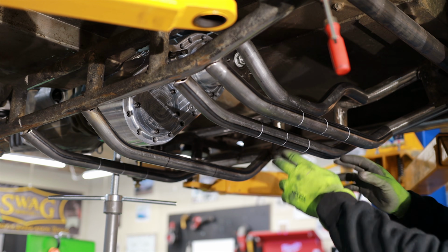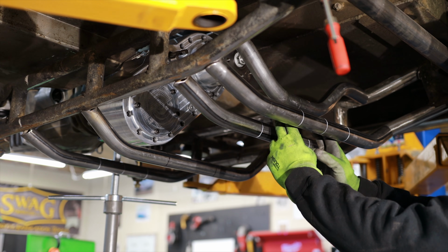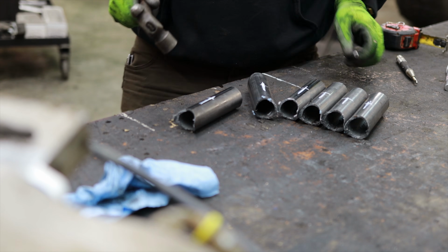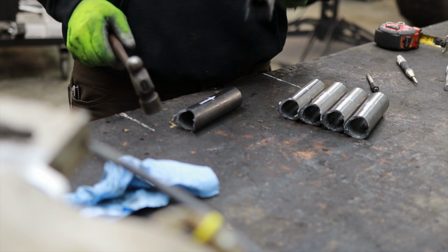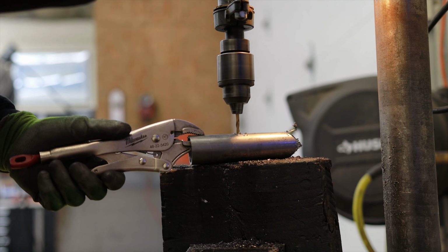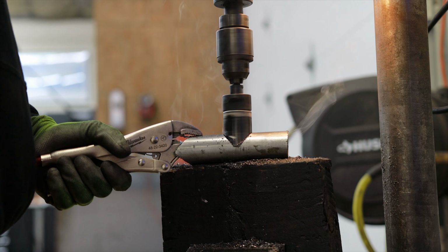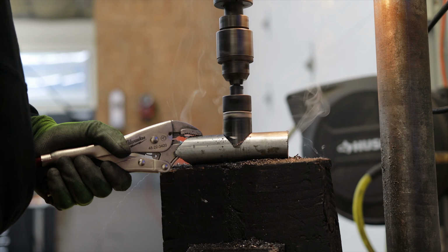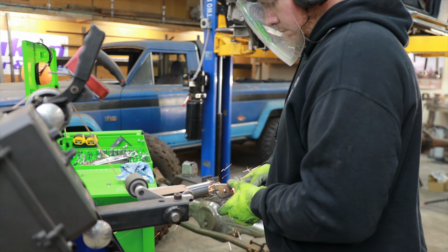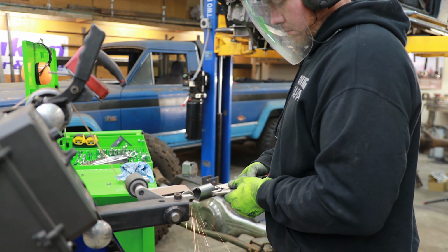And I immediately changed direction and decided to take advantage of that rear double height cross member. I think that this has got a huge benefit in rigidity, and it's going to give us a really nice solid mounting point for the rear suspension. I'm just going to have to leave a gap in between the front and the back cross members to make sure that I still have enough space to remove the transfer case without taking out the whole engine and transmission and everything else.